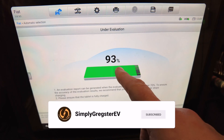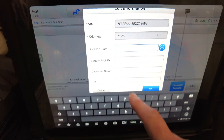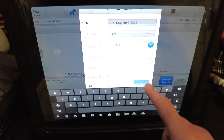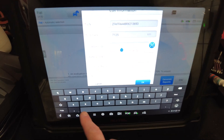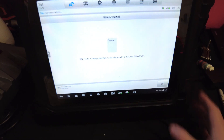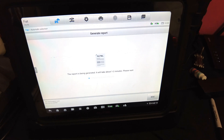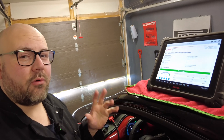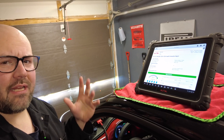Let's generate the report. It said 93% state of charge on the BMS; the car indicated 100%. I enter the license number — it says insufficient digits, but that is my license plate number, so let's just add that. We'll pull the charge port out and it will unlatch. Ignition is already on, we are connected to the internet, and it will take one to two minutes to generate the report. The report is ready — let's go over it. I believe the state of health on this car would be around 94–95%; let's see what we got.